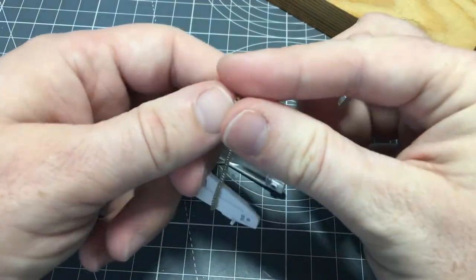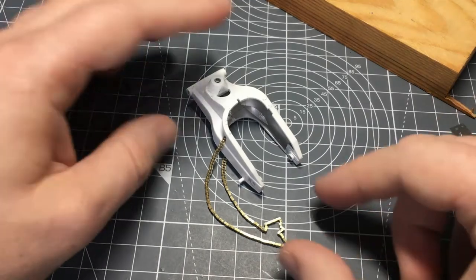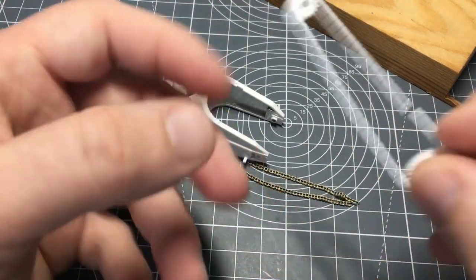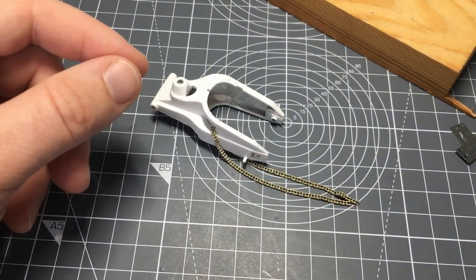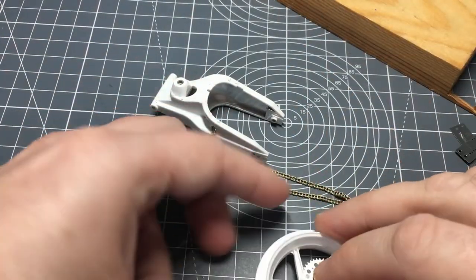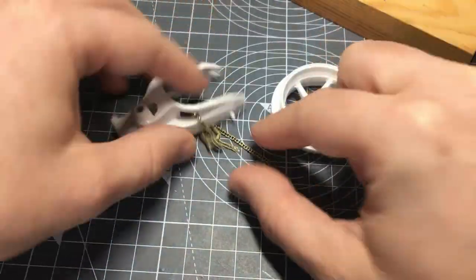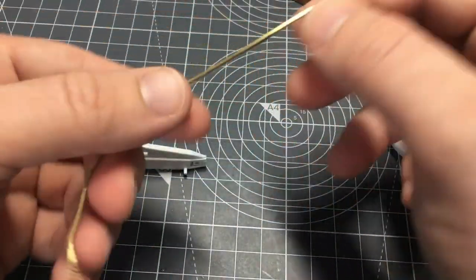and then join the links up here in the same way that I just showed you doing the other one, and then you're ready to put the sprockets on the rear wheel, which is over there, which will have your rear sprocket attached to it like that. So once you're ready and you fit that, and then you can wrap the chain around it as you're fitting it, and then you've got a fully working chain.